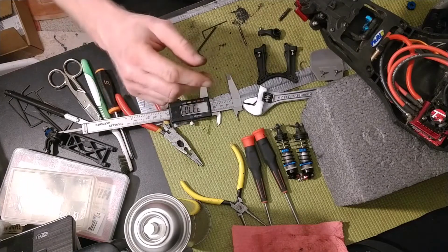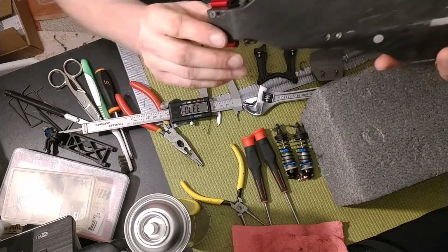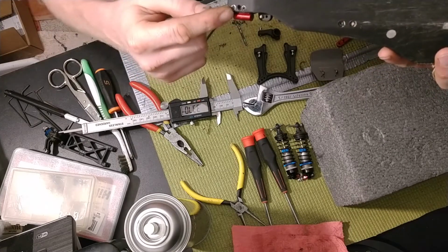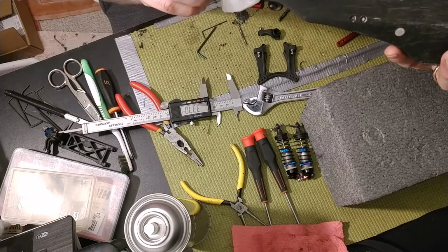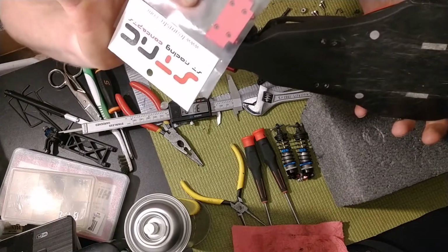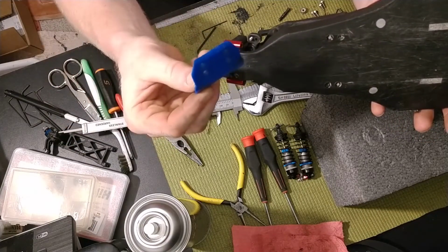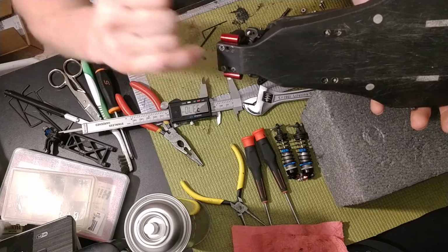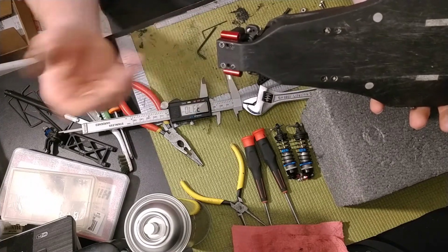So there we go. Another thing I'm going to add here is, if you pay attention here, I got an aluminum block in there. It's a Team STRC brand for 4.2. You see there's 6 holes there. That's a stock setup for a boost. The reason why that center one's there is for this stock front bumper. I think it's a circuit bumper or a boost bumper. But here's a stock one for 4.2. It's got 4 holes. RPM bumper's got 4 holes, right? So if you want, you can upgrade to a 4.2 bumper. Or, like I did, if I took this apart, you would see I got 2 more holes drilled in there. So I can use my stock, because again, I bought a roller 4.2 and I'm gonna use it again.